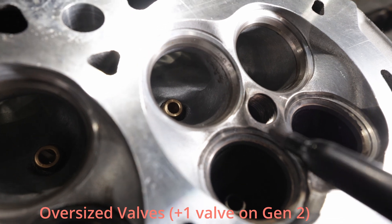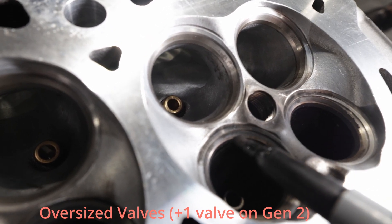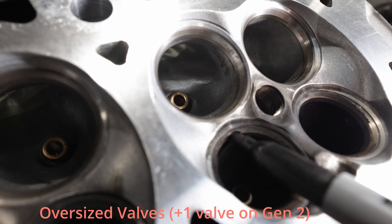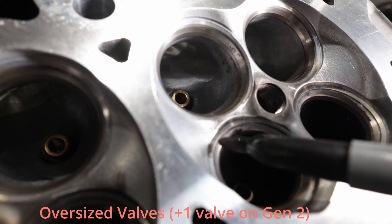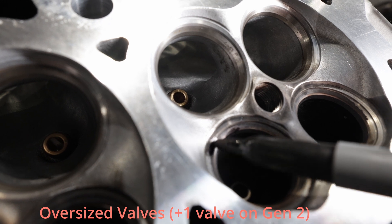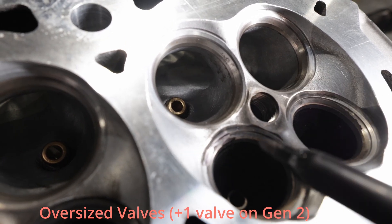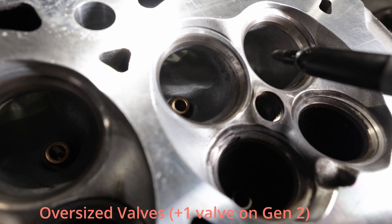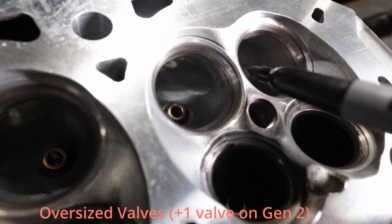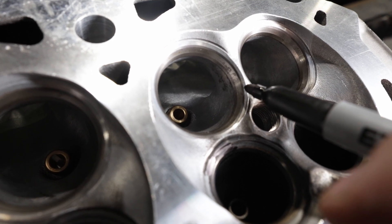So let's go over an issue I saw right away. Here is the 45 on the exhaust. You'll see that there's actually a pretty decent top cut above that, and that's what you really want to see, because a valve seat's like a heat sink. If you take away the heat sink, there's going to be problems getting rid of that heat, and you're going to have valve train issues.